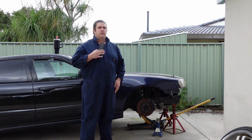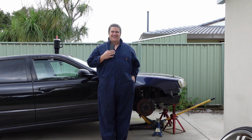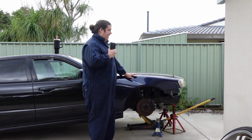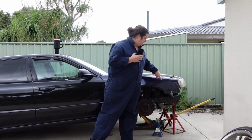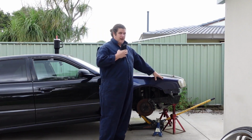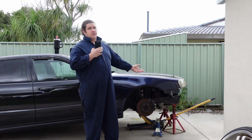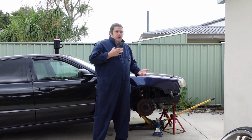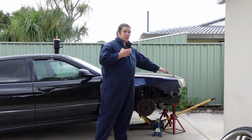So who would have thought that this would take me more than one day? I did. Rears are fine, obviously. We did that. Front, I could roll them, but the issue is that the front of the guard isn't attached to anything because we've got the tube front on this. All the mounts for here and here are just non-existent. So if we rolled this guard, I would definitely bend it. At first, I was like, I'll just put some cable ties on it. Boopity boop. It's just stupid because I have to secure the front of this guard anyway.